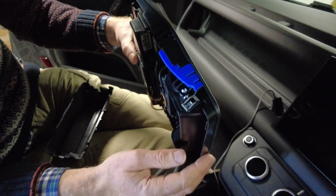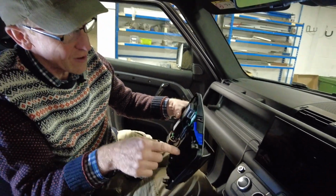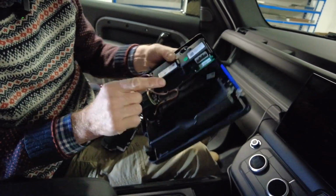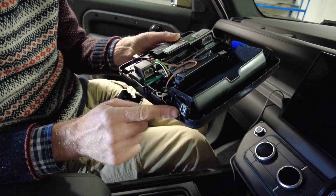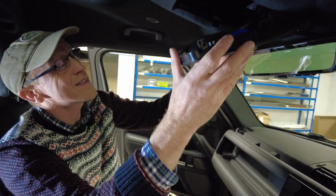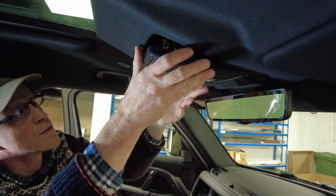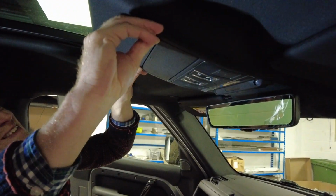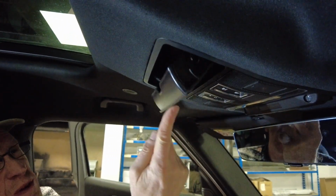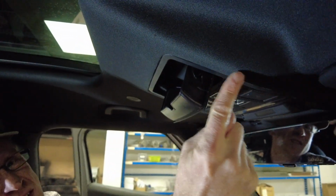And will that stop the problem? It rigidizes this whole area and stops any relative movement. We only need it on this side. There is no cog on the other side, there's only the spring cog, damper, on the other side. So let's see if that does indeed fix the problem. Right, let's give it a go. So there we go. That is it. I think it's the distortion here that was causing the problem.